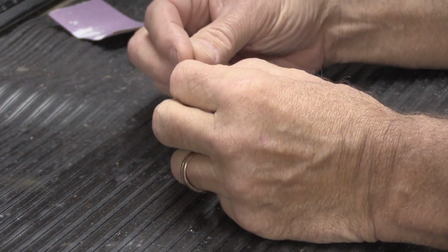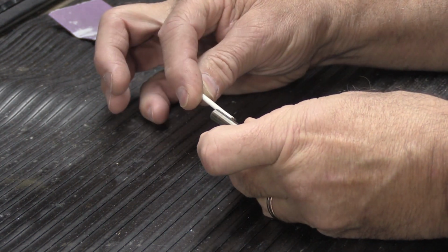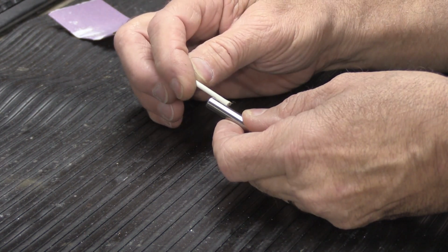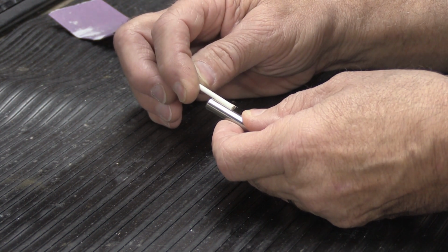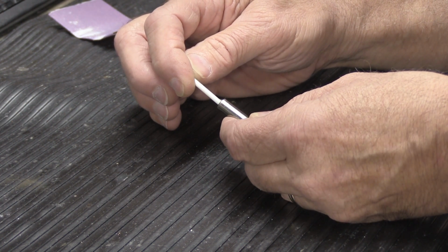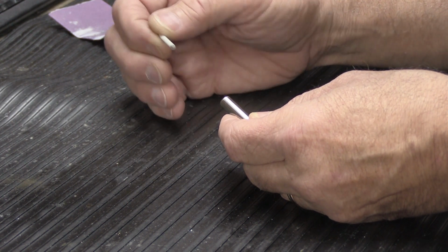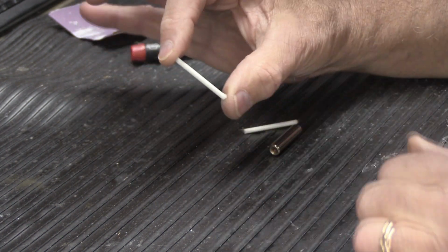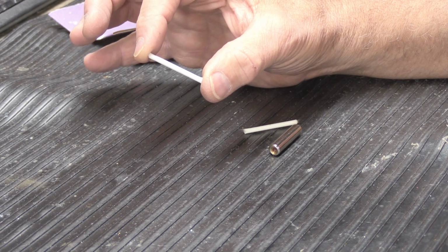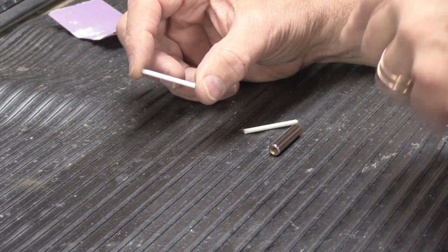What we do is we take the tip material and we insert it all the way down into the full depth of the hole in the end of the plunger so that the end of the rod sits against the bottom of the hole so it cannot be driven back in. It gives it a lot more security. It won't fall out, and also I'll show you how we make sure that doesn't happen, but it prevents it from becoming a problem later on from all of the pounding on the brass tubes. That's why we're starting off with a 1.25 inch piece, and that's also why you can't just buy this pre-made and then stick it in the hole of your plunger, because you have to make it up in each end as you go.